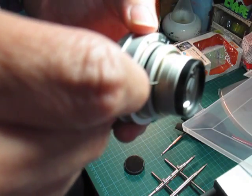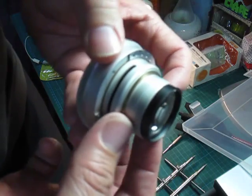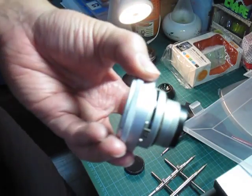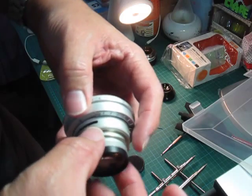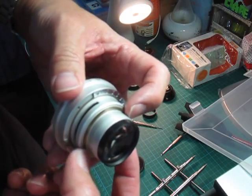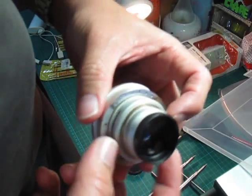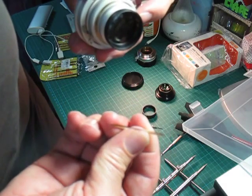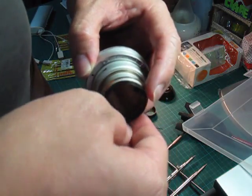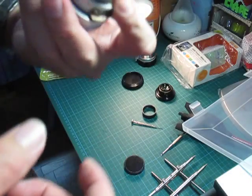You can see that there are some washers here. This washer is for adjusting the focusing distance — if you find that your lens is front or back focusing, you could try to add or remove washers to change the distance so that you get more accurate focusing. But of course, if there's nothing wrong with your focusing, don't mess with this. These washers are very thin, but just that little bit is enough to affect your focus and could put it off by quite a bit.